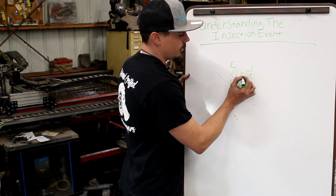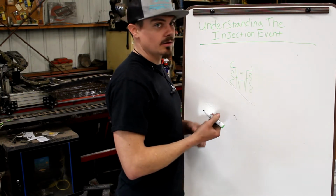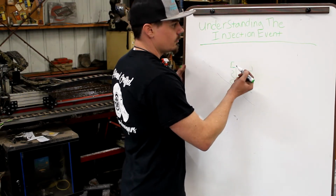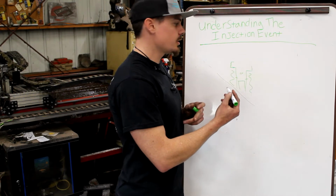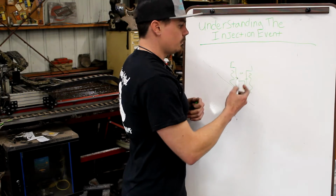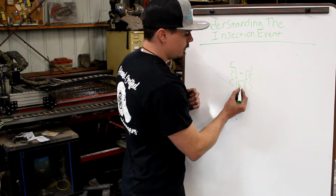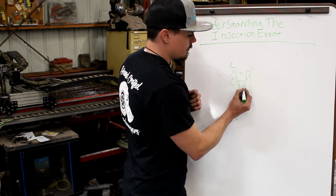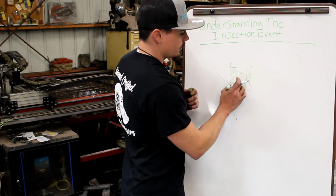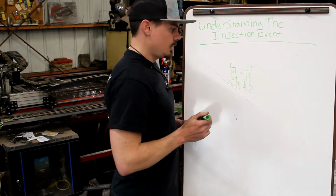And now all the fuel in here begins to increase in pressure because everything's connected together mechanically. It's going to begin the injection event as soon as the pressure is enough to open the pop pressure on the injector. And then it'll continue to rise in pressure, but maintain the injection event until there are machined ports on the side of here that, once they raise up high enough, will uncover the spill, these are called the spills, and all the pressure will bleed back into the case.